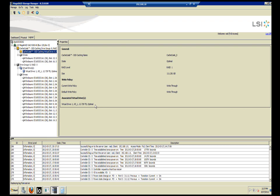Right, right. And I see a lot of applications that you can create on here, if you really wanted to be robust. Now, do you recommend multiple RAID arrays on the 9265? Is it able to keep up? I've got a lot of engineers that will use RAID 10 in a very robust VMware environment. Mm-hmm. And so they have a lot of high IO demands from those virtual machines. Sequential databases that they're needing. And so they'll do a RAID 10, and of course they'll have some needs for performance, faster than a normal bit bucket.